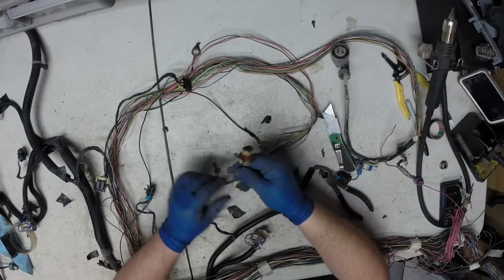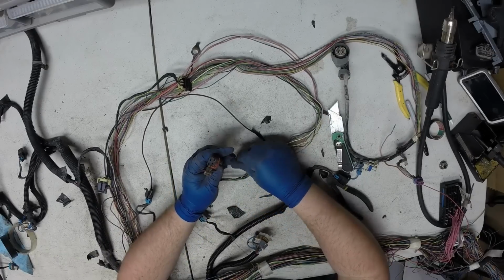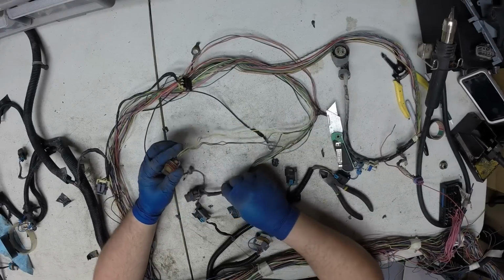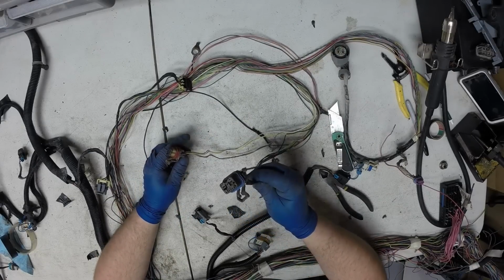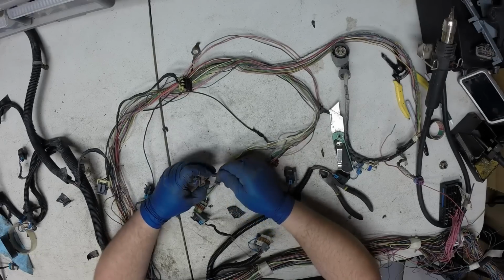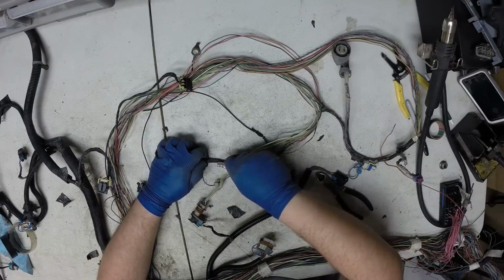All those signals are on the small 4-pin plug. They call it signal A, B, C, and P, which means parity, so error checking. All the wires on this one can be pretty well removed except for one ground wire that is needed for this other plug to function right.